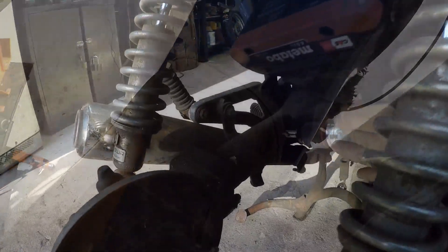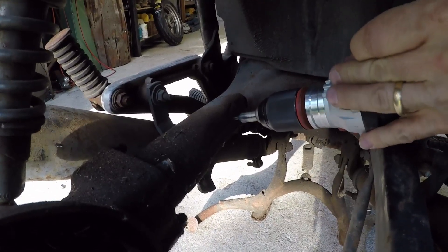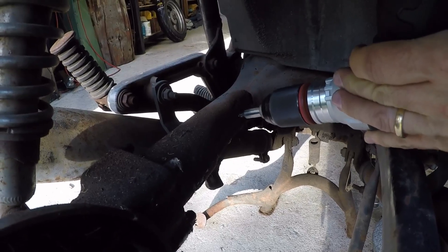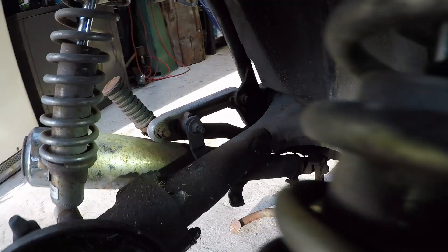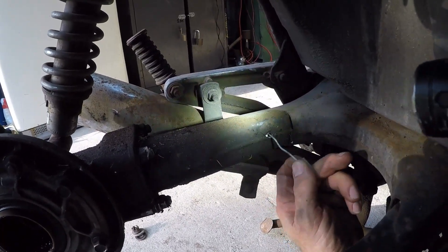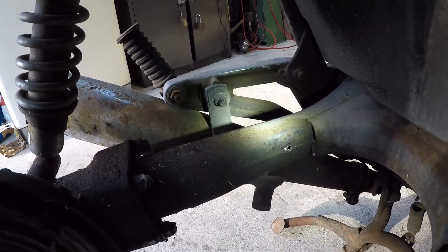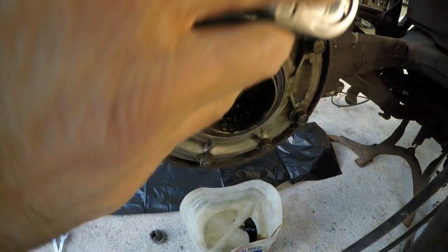Getting back to the rim - I want to do some machining on the diff area. I'm drilling a hole here; this is not the swingarm on the 650, this is the 750 parts bike. I'm drilling it to see how close the driveshaft is and how much play I might have there to work with. It's only a couple of mils - very close.